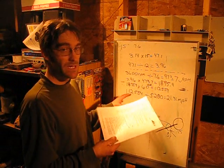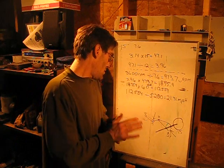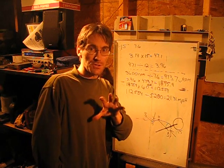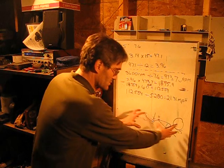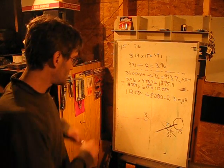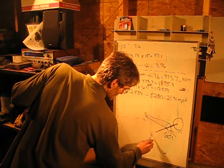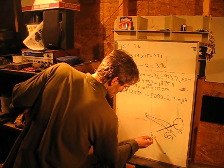This information is on DIY go-karts and I've got it printed off right here. For those trying to figure out the calculation using a jack shaft — this is the exact same type of calculation you would do if you were doing a direct drive from your clutch on your engine going right to your sprocket on your go-kart. Instead of the 7.6 from two different gear ratios, you'd just use the single ratio. For example, a 10-tooth clutch going to a 60-tooth would be a 6.0 ratio — a 6-to-1 ratio. For every 6 times the clutch sprocket rotates, the axle sprocket will rotate once.